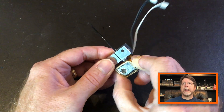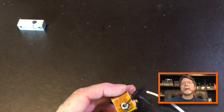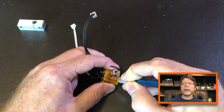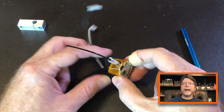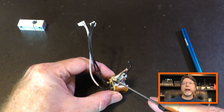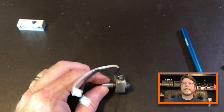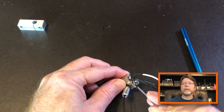Just loosen it a little bit and then remove the cooling block from the tube. This is the Micro Swiss all-metal hot end with the slotted cooling block, but the procedure is essentially the same for the stock hot end. I'm going to use an X-Acto knife to cut across the Kapton tape and the ceramic wool insulating pad. Then the pad can be peeled away from the heater block. You may need to use a flat blade screwdriver to assist in removing the pad. For the most part it should come off easily, but be sure to remove any residual ceramic fluff. I still had a little bit around this washer, but a blade screwdriver and a pair of tweezers took care of that pretty easily.